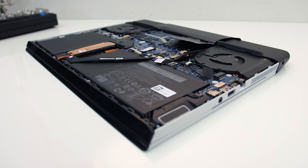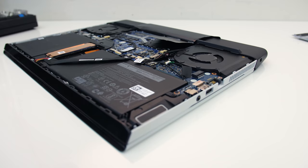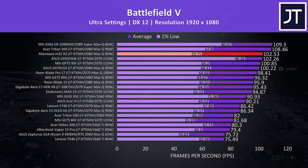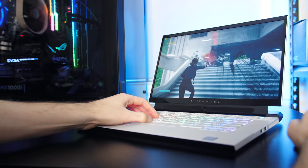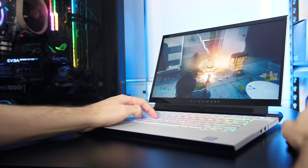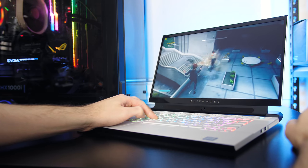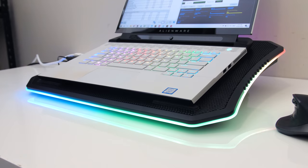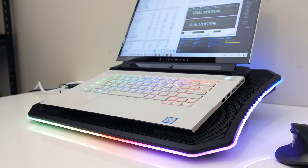In CPU-only workloads like Cinebench it was fine, but when combining CPU and GPU load together the CPU would throttle back once it hit 100°C. This could explain the lower 1% low result in Battlefield 5 — the average FPS is well up there due to the 2080 Max-Q, but the 1% low suffers behind many other machines. Performance at lower setting levels where the CPU matters more occasionally dipped back as the cap gets hit. For example, once it hit 100°C it would drop to 90 briefly, then back to 95, 98, and 100 — fairly big swings that affect clock speed and performance. Faster fan speed, undervolting, or a cooling pad should help with that.